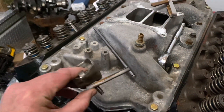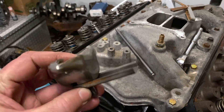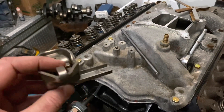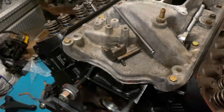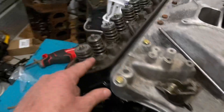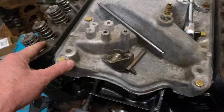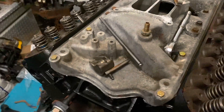These rocker arms are a pedestal-type system — not adjustable. You tighten the center bolt down to 25 foot-pounds and that's it; there's no adjustability in the valve train with these rockers. When I tried to put the rocker arm on with that 8.1-inch push rod, I couldn't even start the bolt — the push rod was so long that the threads wouldn't even engage before the rocker was tightened up. I couldn't get those push rods in at all.